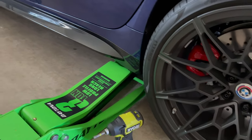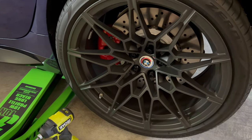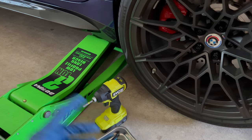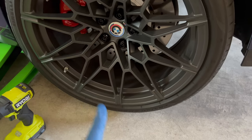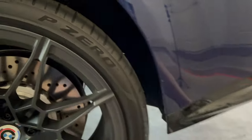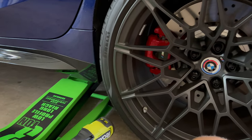I'm going to throw on the gloss slatted black reflector deletes and that'll clean up the rear. I'm going to show you guys how to do it — a couple of tricks that make it easier if you have a couple simple tools. I like to jack up the car — you can remove the wheel, but I have a couple tools that make it simpler. I just jack the car up until the wheel is about to come off the ground, which gives me a little more gap back here.